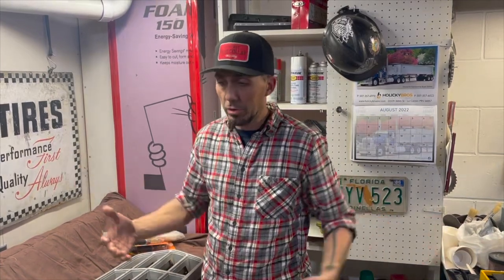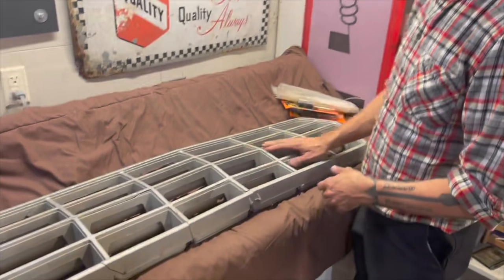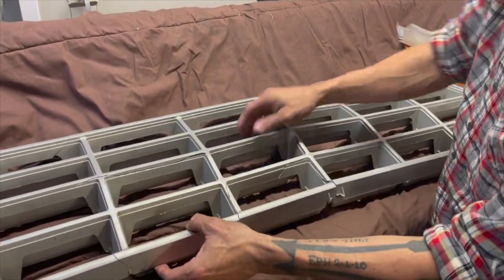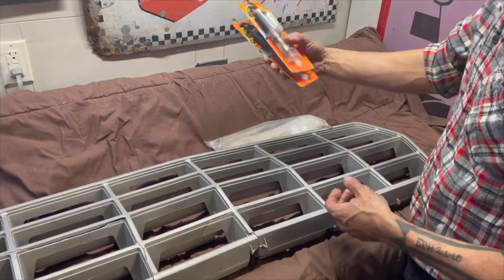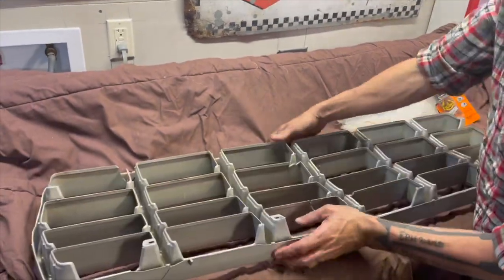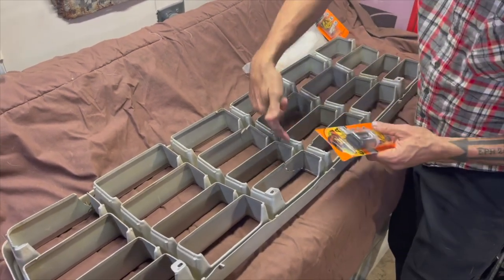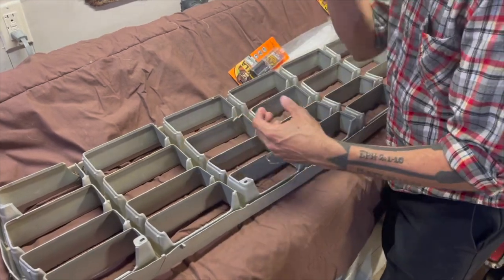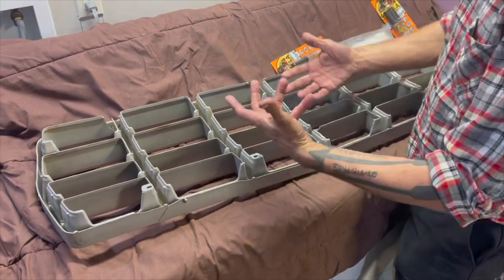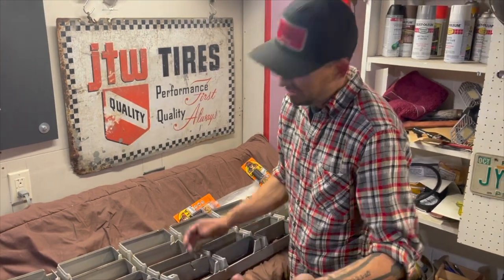Not before we stop and have a taco break — Taco John's, not a sponsor yet, but that'd be great. So we're hanging out downstairs in the basement at the workbench area. It's a school night, and sometimes we do little miniature projects like this throughout the week just to keep the project moving. We're working on the grill out of the '79 tonight. You can tell it's got some cracks in it and it's more flexible in places that aren't supposed to flex. Our plan is to use some zip ties and some two-part epoxy. We're going to flip this thing upside down and use the zip ties to pull everything tight where it belongs, close up those cracks, and then use the glue on the back side of this grill. Strengthen it up — and nobody will ever see that. After it's dried, we'll cut those zip ties back off, flip this thing over, give it a little scuff, shoot it with some fresh paint, and make the front of this truck stronger.